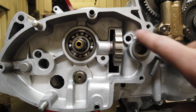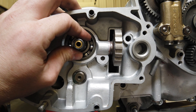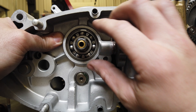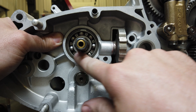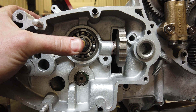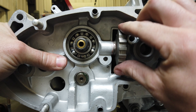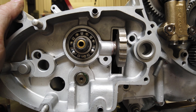Once you've got that, install your Allen, your Phillips head, and your bolt down here. That's how you assemble a four-speed gearbox. Once it's all assembled, run it through and make sure you've got all your gears. It's important to pull the main shaft up against the bearing race because that's where it's going to run — if you have it pushed all the way the other direction, it'll actually cause things to bind up because you won't have proper alignment of the gears. So always pull that back again once you're testing. That's pretty much how you do a four-speed gearbox on a Triumph.